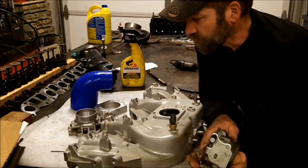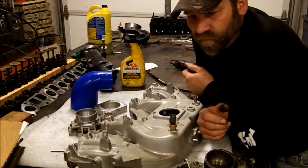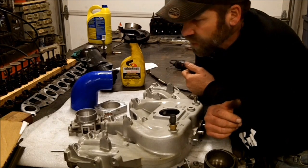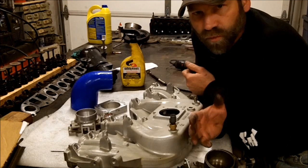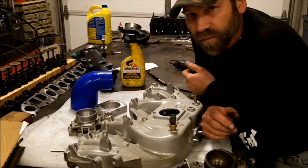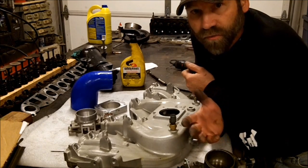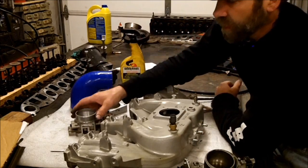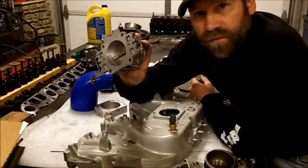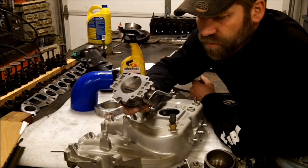I really believe that's necessary, because for one, here you've got this stroked motor. If you're running a 4.6 or 4.7, a typical 4.7 liter motor has around a 65mm throttle body on it right from the factory. So why shouldn't we be running a 65mm throttle body? Now, here I've got a bored out stock throttle body, and you can get it to 60mm, maybe 61mm.